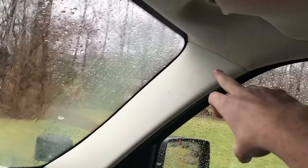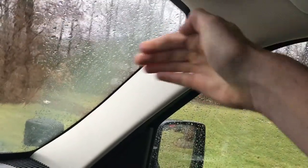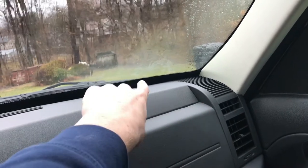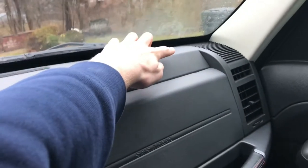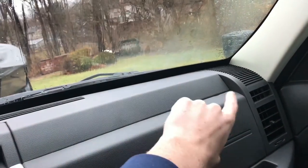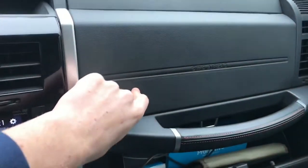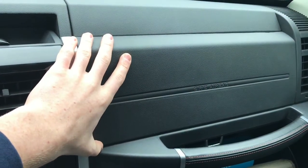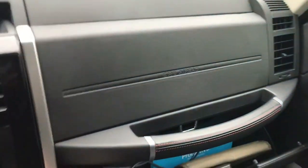For the tweeter over here on the passenger side, you want to take off this A-pillar — grab behind here and pull out this way, and it should slide out. The tweeter and vents trim piece is also held in the corner up there by a bolt. Once you have this dash piece off, you can get to that bolt, take it out, and then start prying on the edges of the vent and pop it out. Don't mess with the airbag — I didn't have to do anything with it or run wires through it, so that wasn't a problem.